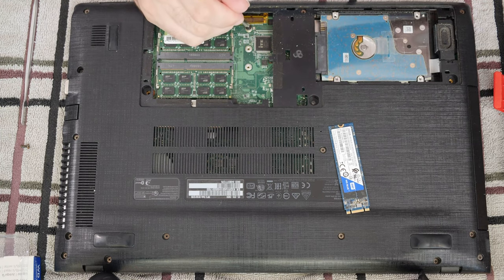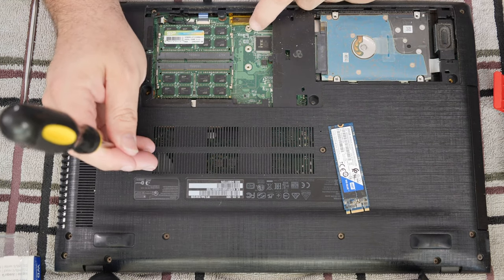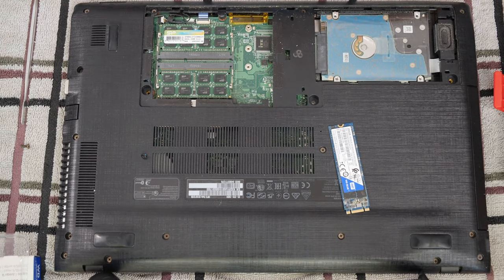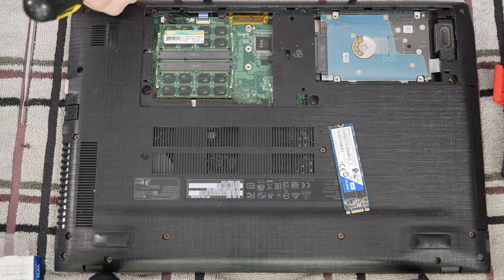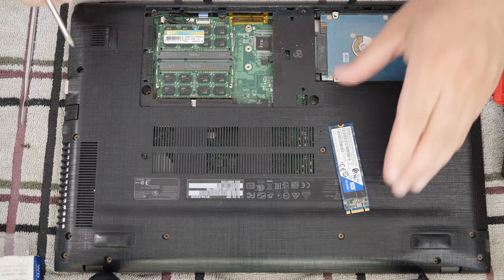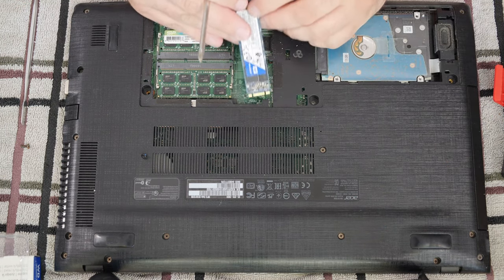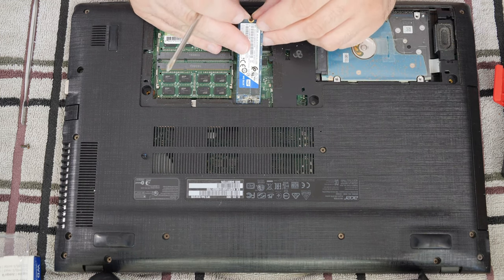This post, which I'll try to show you, is actually removable. You would need to use a small socket — not that small. If you want to stick a 22-42, it is a 5.0 millimeter socket. So if you need to remove this post to put a drive in, you can. This is where the drive goes. This computer should take both SATA type, like this, and PCI Express.